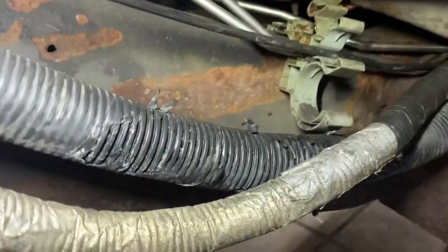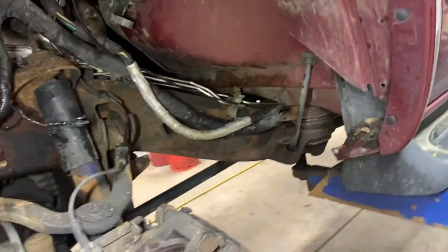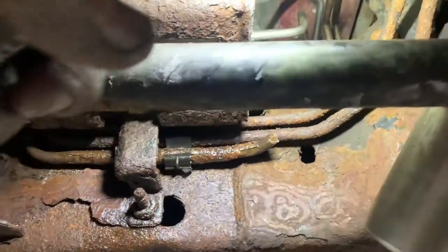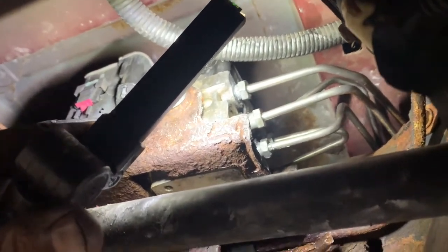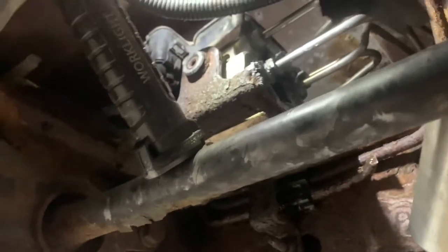I got it in the front. They're all going to shift when you push the other one in. So all I need to do is fish the rear master proportionate valve line to the back and put it in the ABS unit. I shoved it in there — now I've got to go underneath and straighten it out. I straightened it out, pulled it through, and pushed it underneath all the other lines and got it in there. All in there and they're all tight. Remember, the last two went in underneath the others.